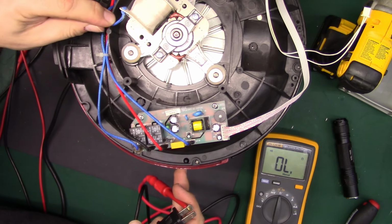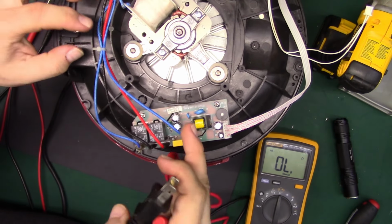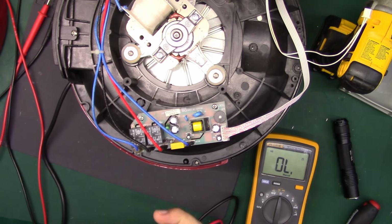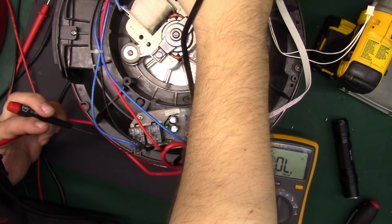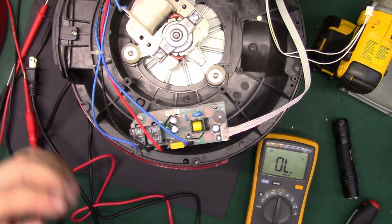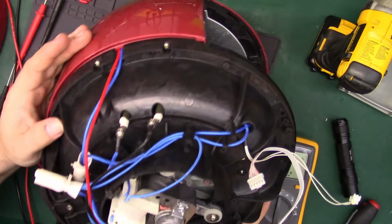Are you looking at the correct wire? Sure looks that way. AC in N. Let's see, and that goes over to all this. Let's see, this one? Nothing. Nothing. We may have a bad power cord, or a kink in the power cord. That's actually a first. In one of these, I really expected us to have an electrical problem in here, but I am not getting continuity.